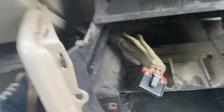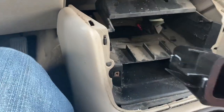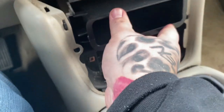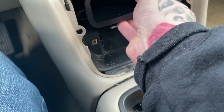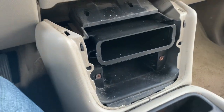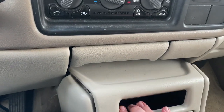That's pretty much it — you do not need the cassette unit, just tuck the connector back up in the dash. Where your cassette player was, this is just an eight-dollar Amazon special, and it literally just slides in there — you'll feel it snap into place.